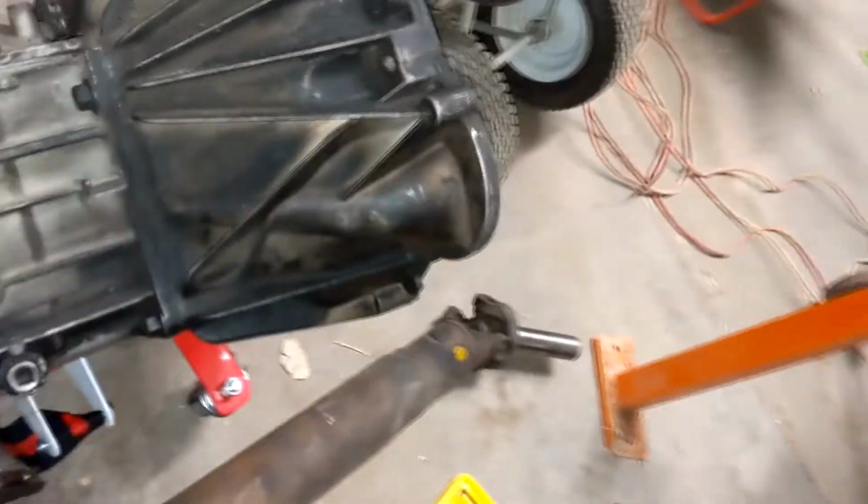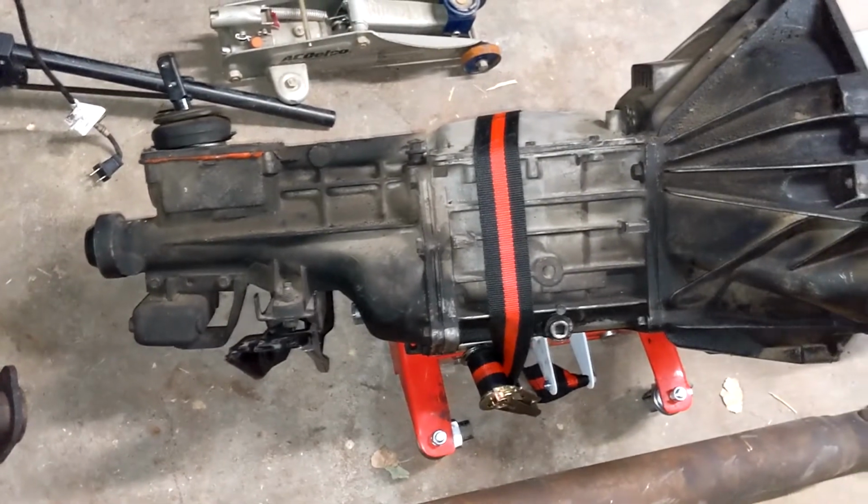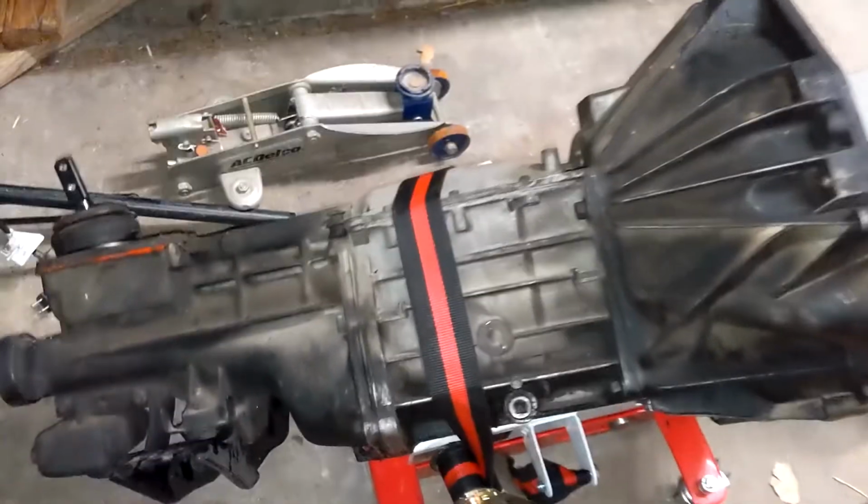And the other thing is the 2 bolts at the very top are super hard to get to. So you're gonna need a lot of extensions and a universal joint. I tried doing it the Chris Fix way, where you went behind the engine on the top and did all that. I don't think that'll work on the 3.8 liter V6. His car was a V8, 4.6, yada yada.